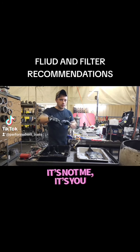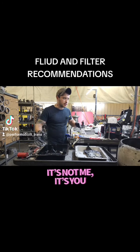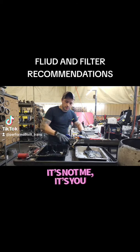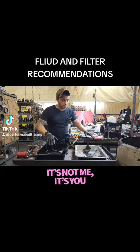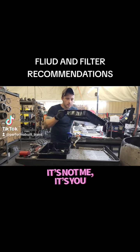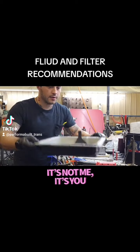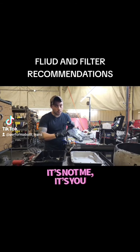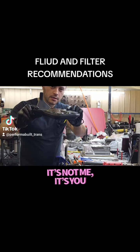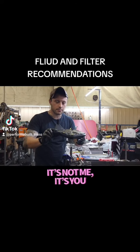This is for mostly our product only. With the 4L60E — because the 80s and all the other transmissions we do only have one pan — with the 60E, this doesn't have to be scary or confusing, so stop overthinking it. With a level one or a level two, you're going to get an OEM deep pan. So when I tell you deep pan on the phone, this is probably what you got. That pan is only going to take this filter. It's an inch thick. It's an AC Delco. Don't ask me what filter I recommend, because I recommend OEM, because it's the only one they make.